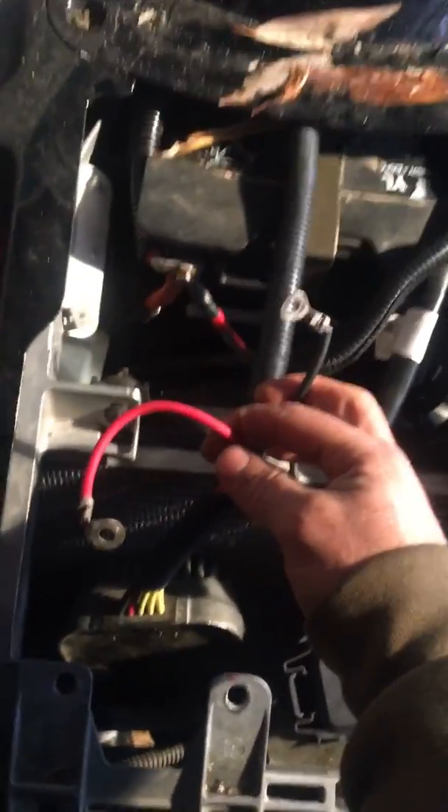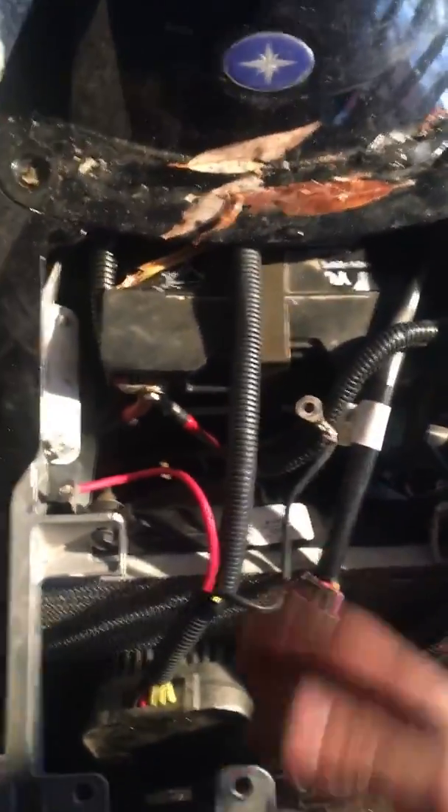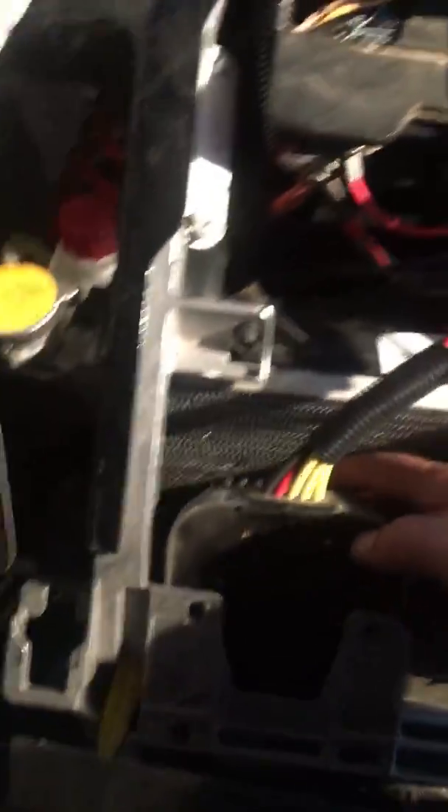So your stator is good. Those three yellow wires come back to the regulator block, which outputs DC to the battery and regulates the charging while running. You test those next, and if it's running and not producing voltage, you already know. You can try it again just to be thorough — I've already ascertained that this regulator is faulty.